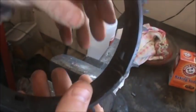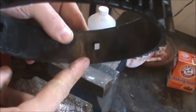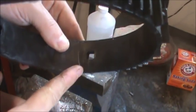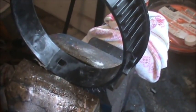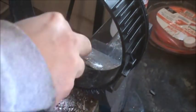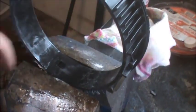What I'm also going to do is on the inside — because I don't want to build up there as it will be in the way for the snowblower chute — I'm going to do a plastic weld on the back of this. So we'll show you that other process if you didn't see my other video. First thing we're going to do is clean the back side of our plastic. Isopropyl alcohol works. There is some grease on this plastic so you want to get it clean.